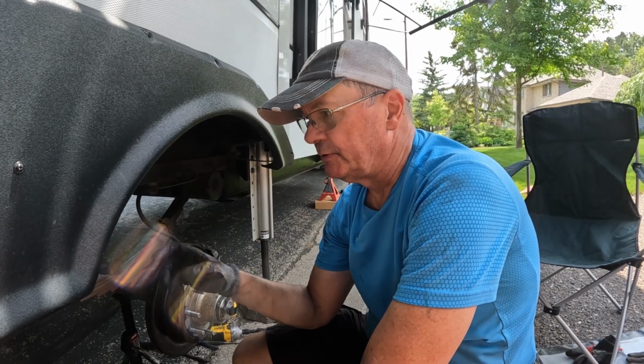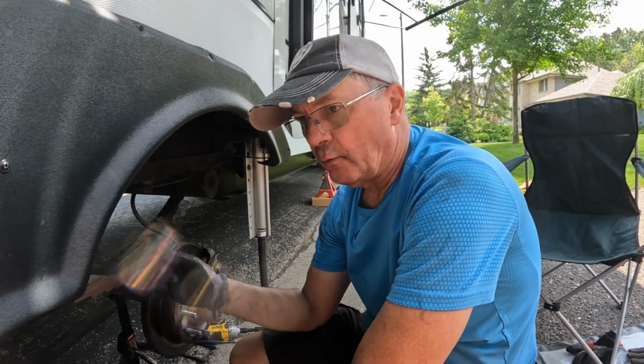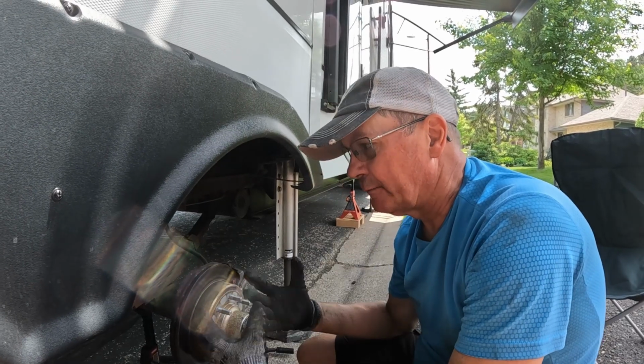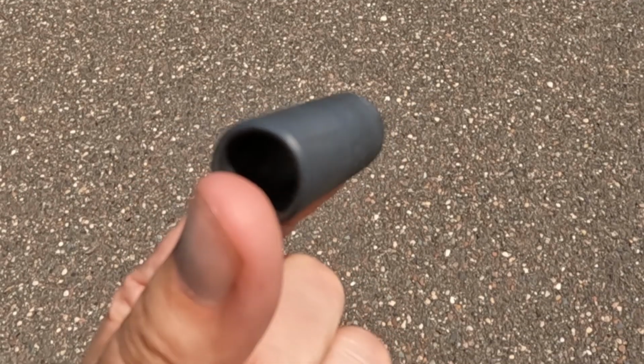If you decide to use a wet bolt with a brass or bronze bushing in there, then you would need to grease, but you've only got the 2 bolts on the end. So it's significantly reduced on the amount of moving parts and parts that need to have maintenance on them. So the new springs came with what they call a heavy-duty nylon bushing in the end, which is basically maintenance-free. We'll see how well that holds up over time. You can put wet bolts in there as well, but I'm thinking you'd probably have the same problems with wet bolts in there as we did in the MORryde.